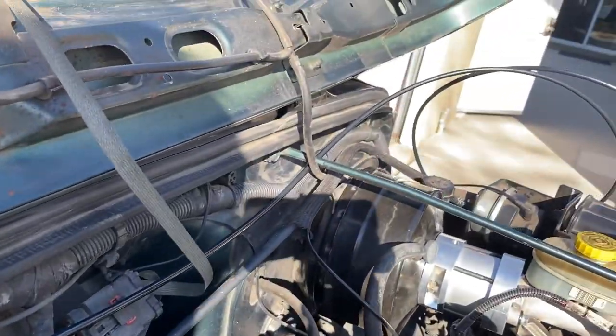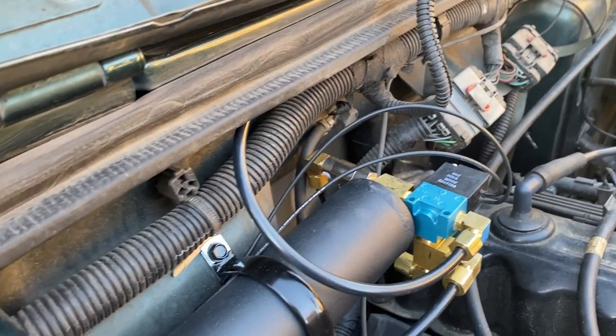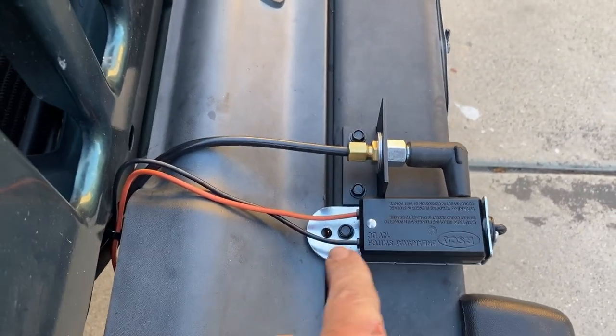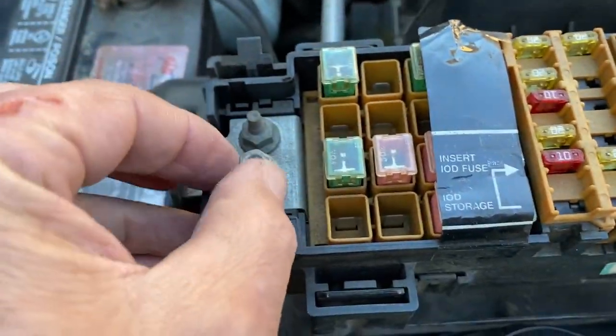The output of the breakaway goes to the M&G brake cylinder, wired along there. The air fitting goes into the M&G cylinder — cap, ferrule, insert. Breakaway wiring: the two wires from the breakaway — one goes to ground right there, the other follows around, comes here, connected all the way through, and goes down to the breakaway switch. The other end of the breakaway switch comes back through the headlight hole just like the air one did. Tie wrap them all together, comes back through here, goes through our 5 amp fuse, and connects to the power bus.